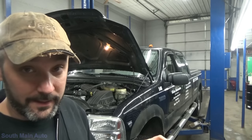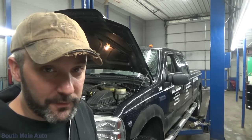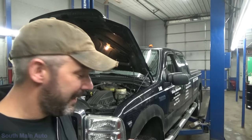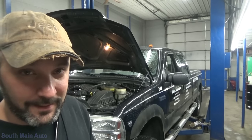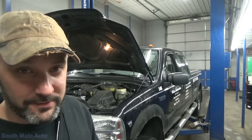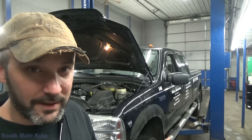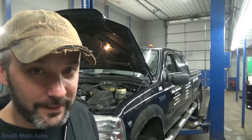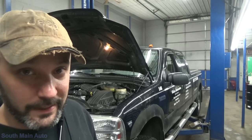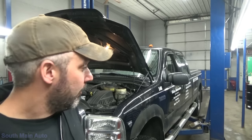Not wanting to cause any damage, I just got out, put it back in locked, and pulled it in. These have a pulse vacuum hub, or vacuum-operated front hub. I'd have to look at theory and operation to be specific. These things have been kind of a disaster since the late 90s when they used them on the Rangers, up until today on the half-tons with those integrated wheel-end hub units. They're pretty cheese-dog, but fortunately they give you the option to just get out and lock it in. The vacuum is not the only option, but this guy told me he wants the vacuum portion of it working.